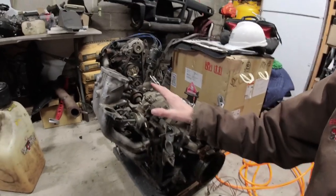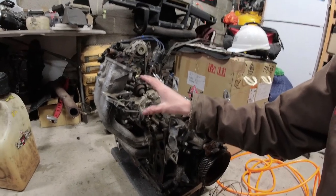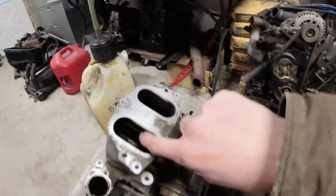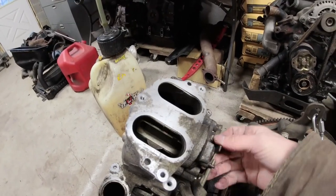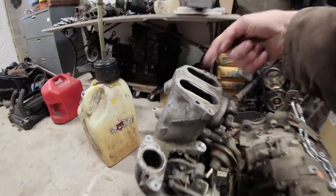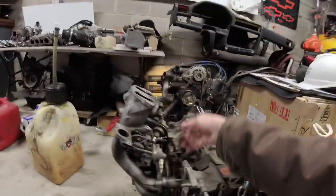That's part one. Part two to ensuring that these valves are functioning properly is actually inspecting the valve itself. So you can see the shutter valve in here. You can see it moving as I move the little actuator lever on it. That connects the front and rear rotor primary runner.